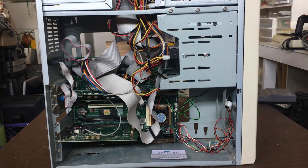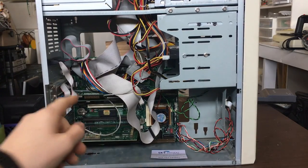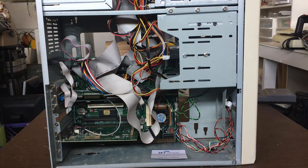The sound card is not the same Sound Blaster 16 Plug and Play as before. It's a board made by BTC with an ESS 1868F chip — an OPL3 clone. It's a very good clone, probably the most accurate OPL emulation chip available, and in my opinion slightly more accurate than DOSBox's OPL3 emulation. It definitely sounds better than the old SB16 PnP, which was more of a Vibra 16 — notorious for poor OPL3 sound quality.